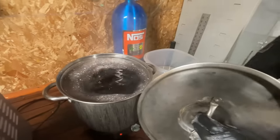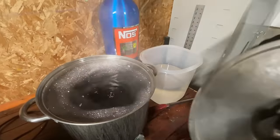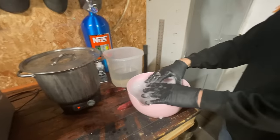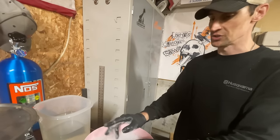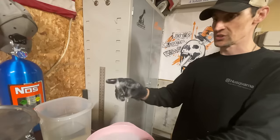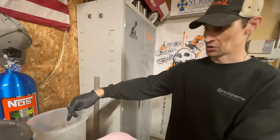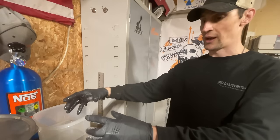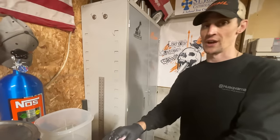Bumper spikes, little clamps, anything that will look good dyed black — we're going to do it. That's going to sit for about 15 minutes. If you have the parts preheated in hot water, the dye takes really fast. Then I shock it in cold water after it comes out of the dye bath — that kind of seals it into the plastics. Then I go back to the hot water, back to the dye bath. I do that three times and it will be a really deep dark black.